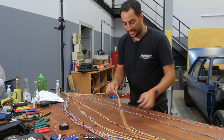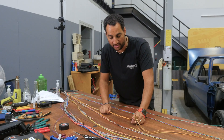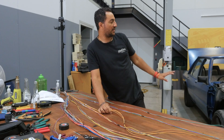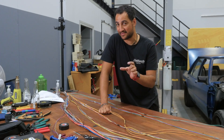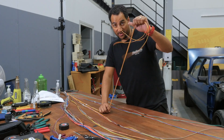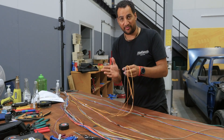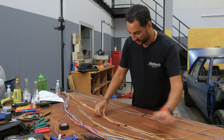Next I've got the pedal — this will be the GM pedal that we're going to install on this. I think it's from a VA model but I'm not exactly sure; there are a few different connectors I've seen for different models of car. That's going to be a fairly simple process — four wires that get split into six because we split the 5-volt up twice and the ground up twice. We'll go through that and how to wire it up together later.